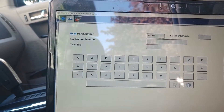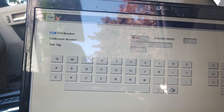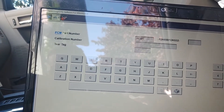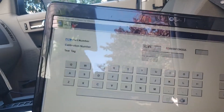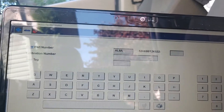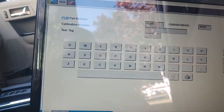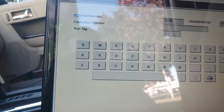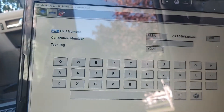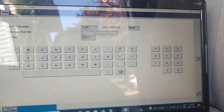In order to get to this area right here, what you gotta do is go to my GT100 video — I showed a process on how to get up to this part. It's basically just keeping your ignition key off and trying to communicate with the vehicle until it comes up to this area. When you get to this screen, make sure your key is still out of the ignition switch. We're gonna finish putting in the data — this was BRB — and next we're gonna put in the tag which is YGJ1. Sorry about the glare, we'll press the tick that's down in the corner.